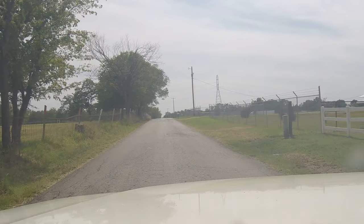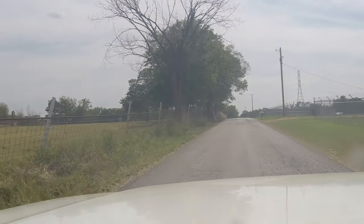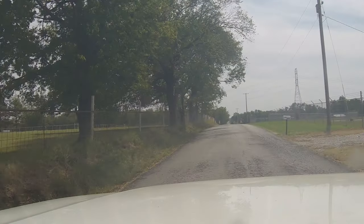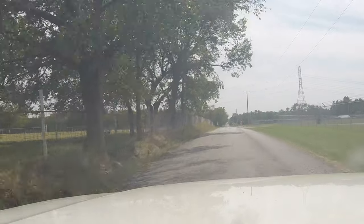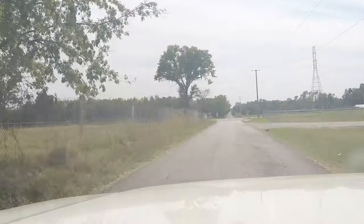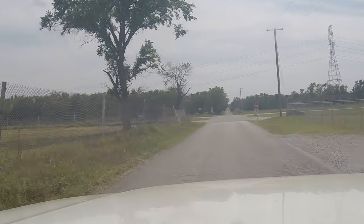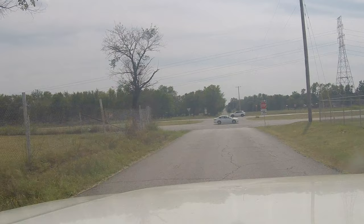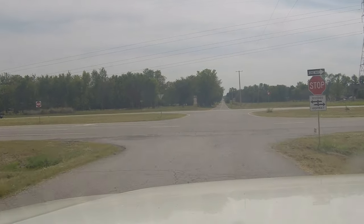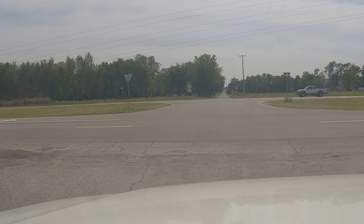First, I thought it was a tire, but you could tell. And then I thought maybe it was something with the transmission, and I got all worried. But anyway, as you saw what I did to kind of diagnose it, and then, of course, once I really got underneath there and got to looking at it close, man, it was obvious. I actually had two of them. One of them really bad, one right back there by the rear differential yoke was the worst one. Then I had one up by the carrier bearing that had some play in it.